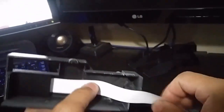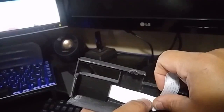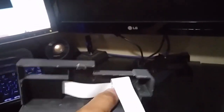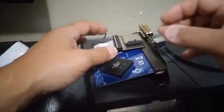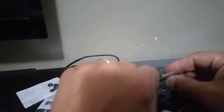So now what we're able to do is run this cable. It actually bends very nicely — just bend it this way, then bend it this way. This part goes inside the CD32. I'm going to go ahead and put that together and show you what that looks like all connected. Here's the expansion card on the riser outside of the CD32. I'm going to go ahead and eject the SD card and then insert the extension cable — okay, hear that click there.